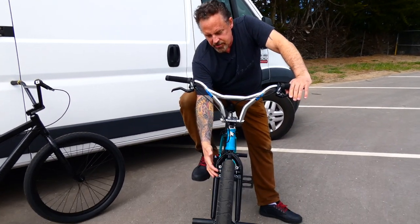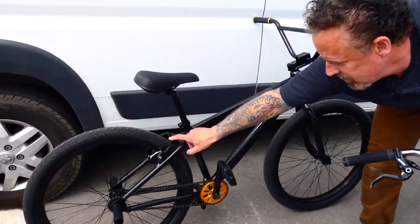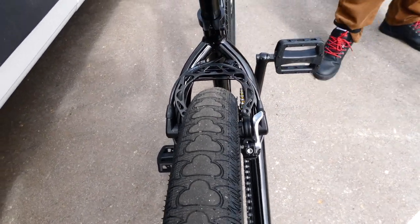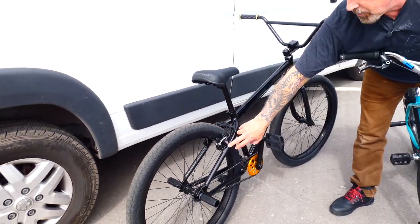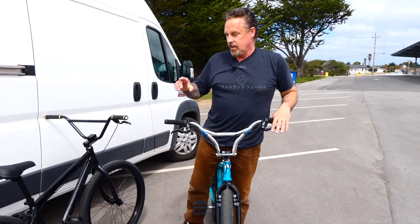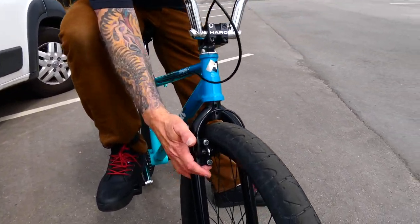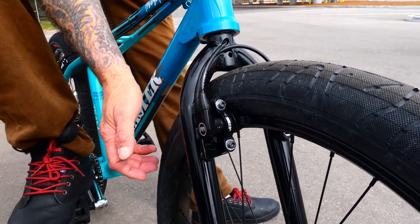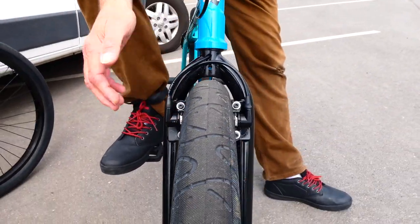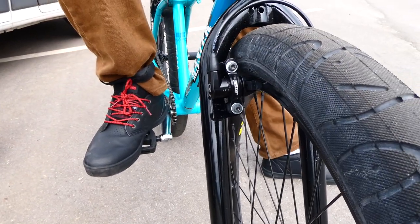These are adjustable in and out, up and down. I did remove the cage — like you can see on Dylan's, the support rack. Let's check this bike out real quick. You check the support bars, this quick release, and this system works really good. But you still get a little flex here in the frame when you pull the brakes, and that flex is becoming critical — like when you're going to loop out, when you need that frame not to flex. The way I know that is we put them on the forks — this is not the super cleanest bracket but I just want to get something to start with. These forks don't flex, and when my brake pads hit the rim, my brake lever stops.